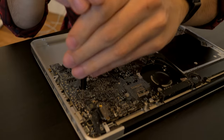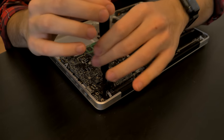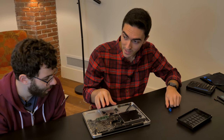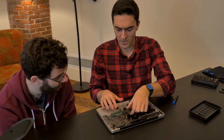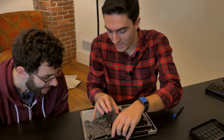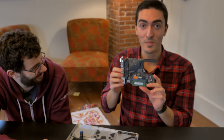So we're going to start by just tearing this computer down. I would recommend, if you want to follow along at home — actually, I don't know if you should, because it's potentially going to be very disastrous. These old unibodies are so straightforward to take apart, especially the 13s. What happens a lot of the times is the logic board gets really hard to take out, because the heat sink melts onto the backlight cover and gets stuck together. And it looks like that's happened here. You hear that unsticking? And just like that, with no trouble at all, we have the board pulled out.